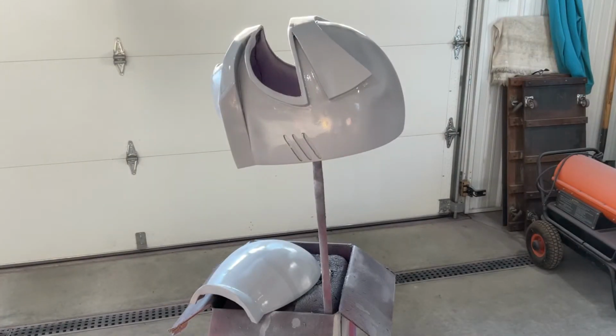Look a little hairy. This thing keeps sliding around, but it didn't fall again. So that's a plus. That first coat of primer is just weird. I changed the nozzle on it because I thought that's what was the problem, but it's still coming out like dry. So it might affect our wet sand. I put a fresh wet coat of some better, a fresh can of primer. So hopefully that'll fix the issue. If not, we'll sand it again. No big deal, whatever. But I think it's looking okay.